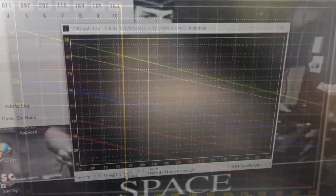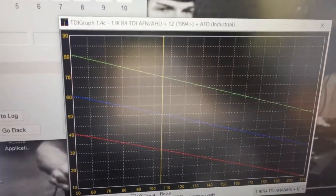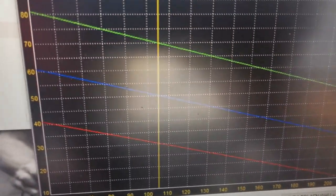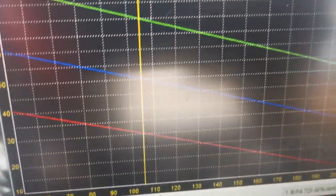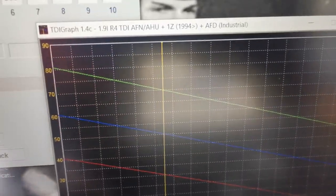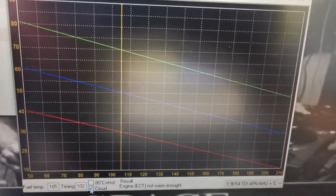Okay, so it's miles out if that's the case. Basically the way this works is it's supposed to be taking samples of what the injection pump timing is as the engine's running and it's supposed to create a cloud of dots. Those dots are so far off the graph they're right up the top, which would explain why the pump timing is out. So I'm going to get changed into my working clothes, take the van for a drive to get the temperature up, and then we're going to address this.